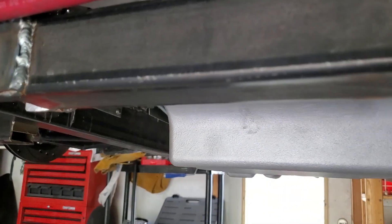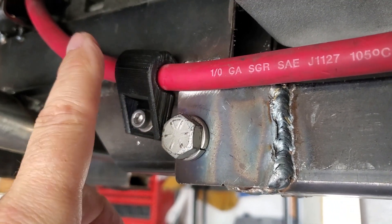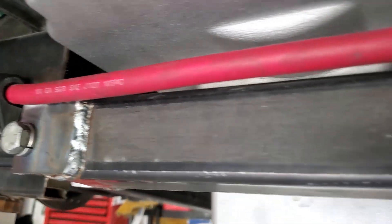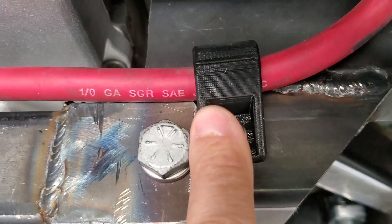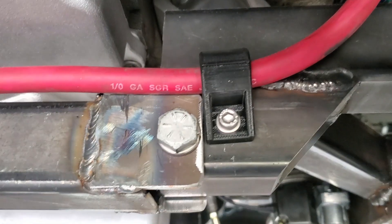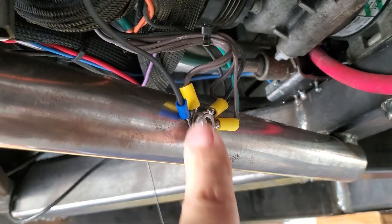The other thing we did was go back to the 3D printer and print some cable clamps — bespoke cable clamps for this one zero gauge wire that is used for the starter. This goes straight from the battery to the starter, delivering all of the current as the starter fires. I've clamped it in two places here. These clamps are printed in ABS and only took about seven hours to print. I printed some spares just in case.